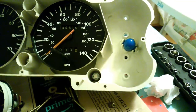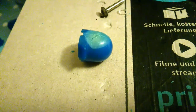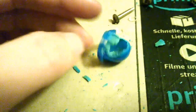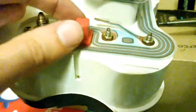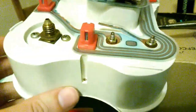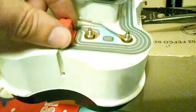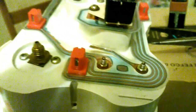You probably want to go for blue LEDs if you want an original look, but I'm going for red just to be a bit different. Here's an example of another one of those covers that's gone brittle with age and heat — it just crumbles apart, so there's no real point keeping these in the car at all. Also, a very quick tip: when pulling these bulb holders out, it can be easy for the bulbs to drop into the main body of the clocks. So either do this before you put the clocks back in, or pull the bulb holders out a little way and grab hold of the bulb with pliers so you can pull off the top without the thing falling inside.